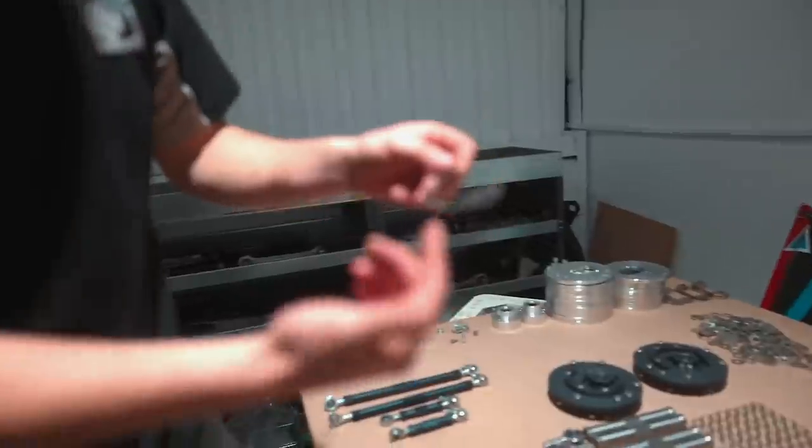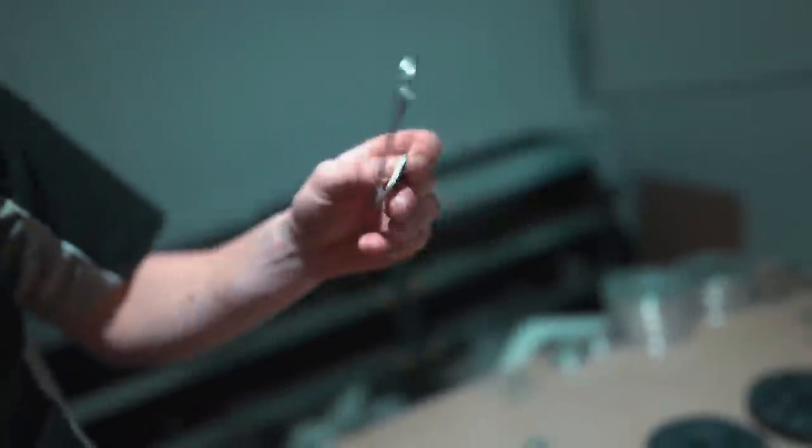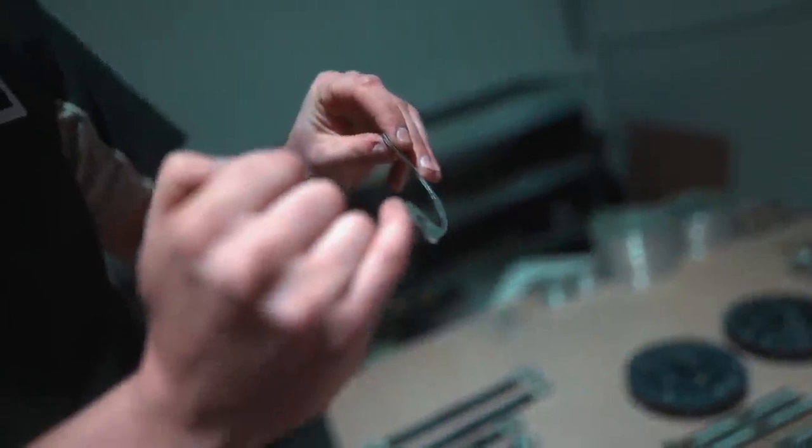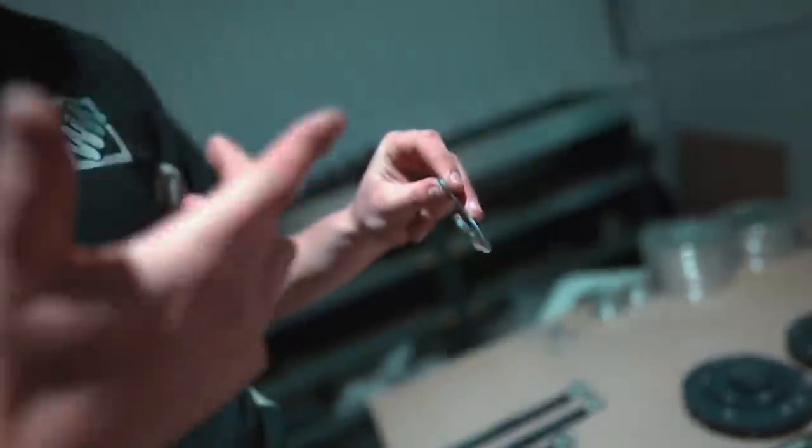This is one of the rear shims. So it looks a bit odd, but this is because every single divot and dent is profiled to miss the original subframe effectively on the car. So it fits perfectly flat against the car and between the lower arm and the chassis. So we spent a bit of time developing those and also developing which thickness gave what increase of camber, and then testing that on a road car or a track car to make sure that amount of camber gave the best use of the tyre and wheel.